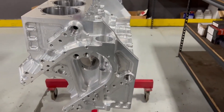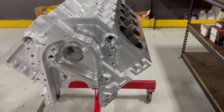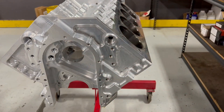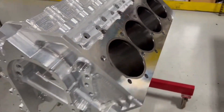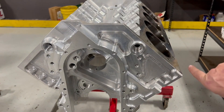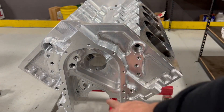It's the same on both sides — water in on one side, water out on the other. Each side of the block is completely separate, not combined, not touching each other. There is no crossover in the head and no crossover in the block. Also notice there is no water through the deck surface — no water transfer at the deck. That's why we need water in and water out, and up on the head I'll show you water in and water out doing the exact same kind of routing through the cylinder head.